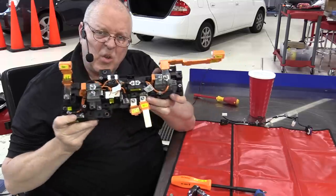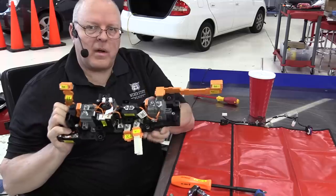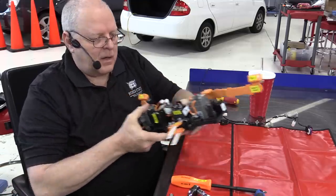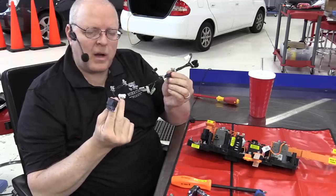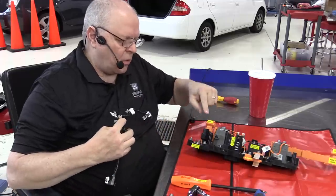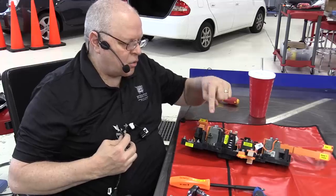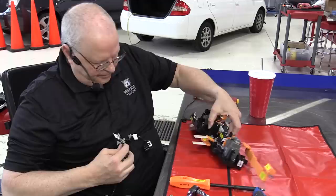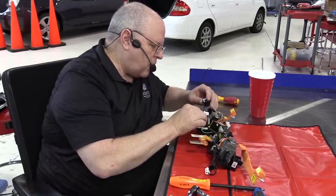Okay, so those are all the components, but we have to control these somehow. And the BECM that we just installed on the battery is in control of these. So there's a low voltage harness right here that has to be installed. We have to be able to read the current off the current sensor. We have to be able to control all four contactors. And so we have this harness that goes on next.